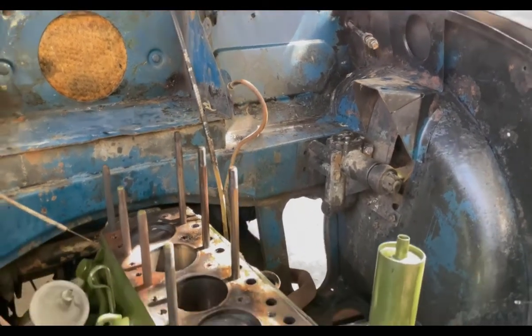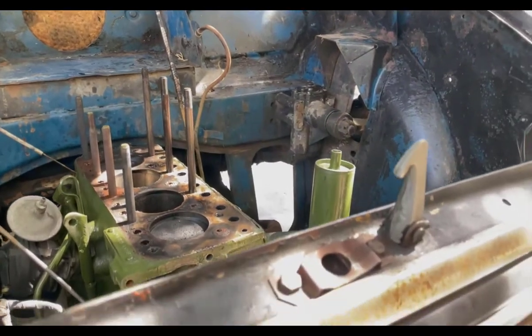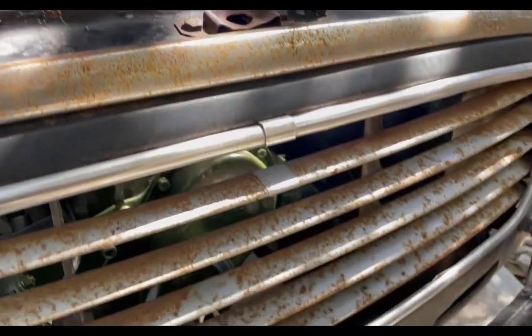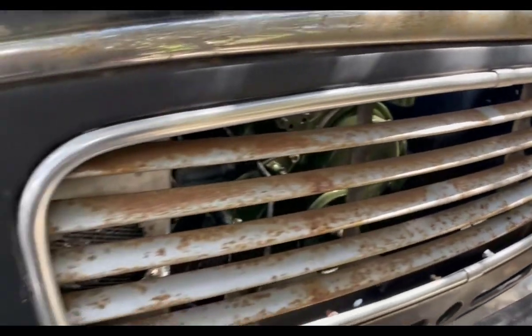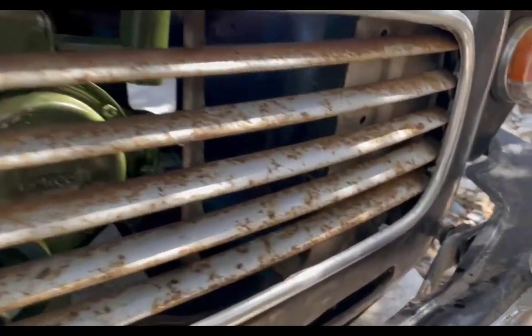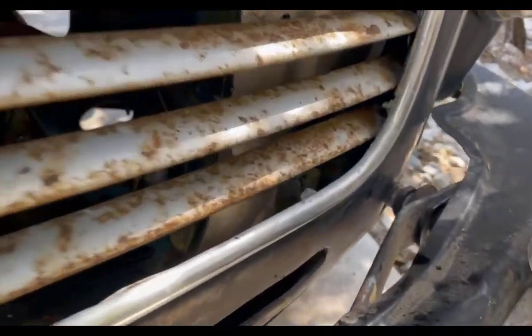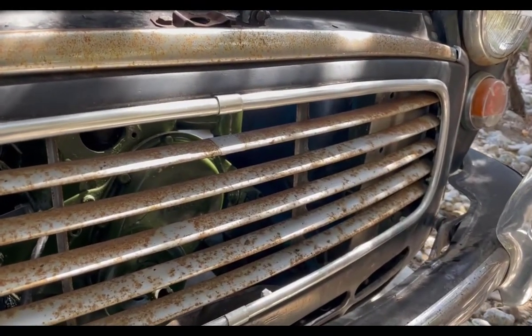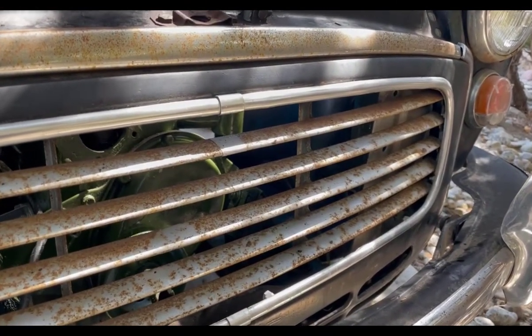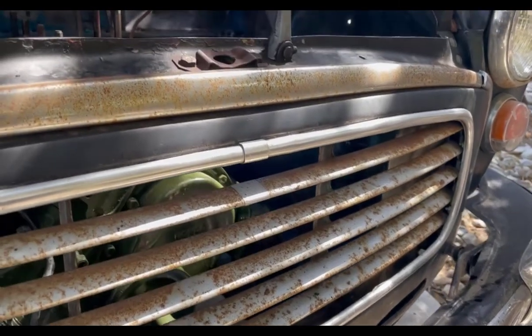I have most of the under the bonnet area cleared out, but I want to take this part out. I'm going to paint inside of here, and this whole front section with the grill comes out and clearly needs to be refinished. You start by removing the front bumper and this little fascia here, and then we're going to pull off that whole front section — which you can pull off with the radiator attached — but the radiator is already off and being refurbished.